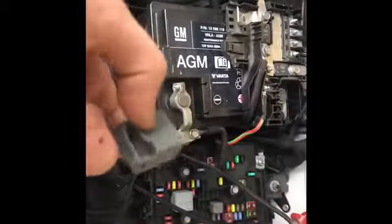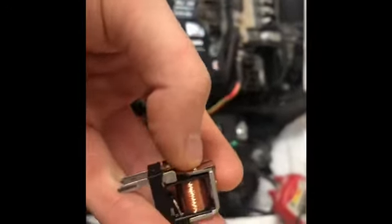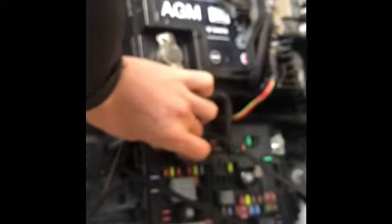I'm having a problem with the starter relay. Normally it has a casing on it but that cracked in the crash, so I took it off. If you push those contacts together it just closes the circuit, and I get the engine to crank. I'm going to drop the car off the jack stands because I feel like the fuel isn't getting to the engine as efficiently as it could, then I'll try starting it.